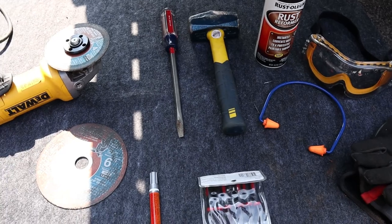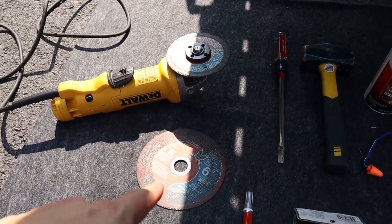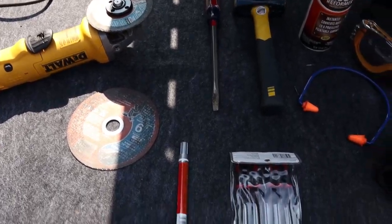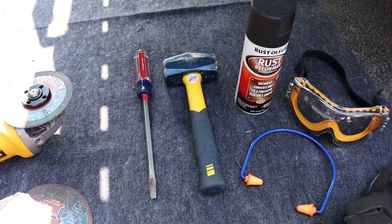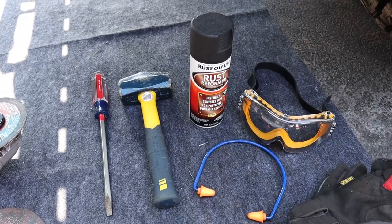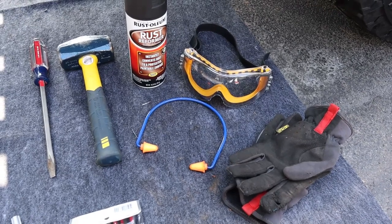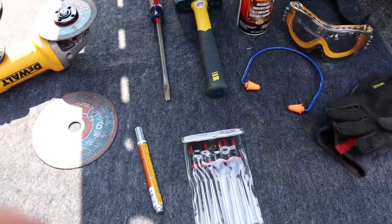This is a very simple process. Here is everything I'm using today — I'll put links for all of this stuff in the description below. You will need a grinder with a four and a half and a six inch blade. The six inch comes in handy towards the end because the leaves start getting in the way. You could use a sawzall, but that might be more of a pain. A paint marker to mark your cutting areas. A screwdriver and hammer to knock between the leaves just to separate them so you don't cut leaves you're not supposed to. Some Rust-Oleum rust reformer or whatever paint you want to use to cover up the bare metal. Personal protection: hearing protection, gloves, and DeWalt anti-fog goggles. And some kind of file set just to get rid of any burrs on the metal.